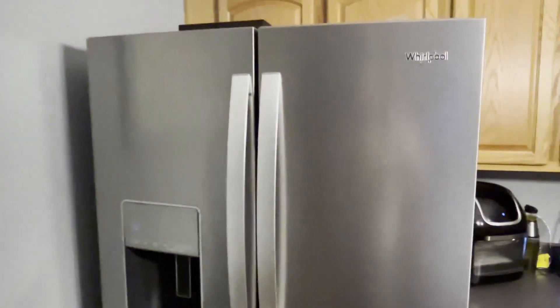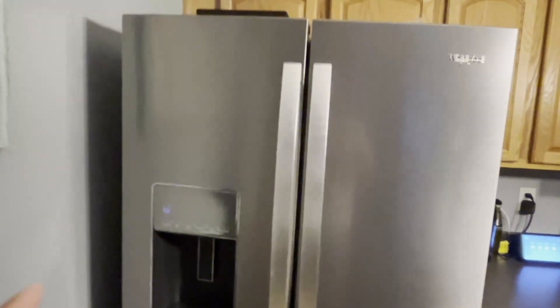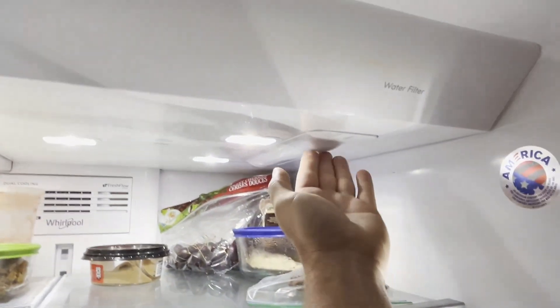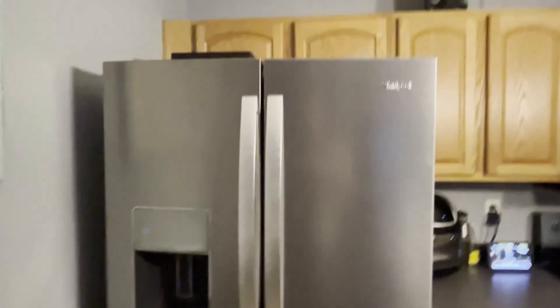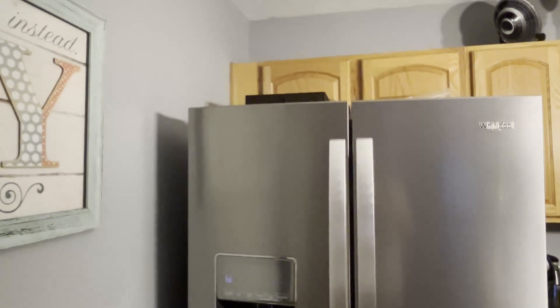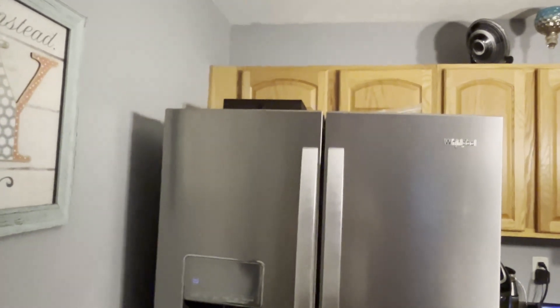Hopefully changing out that fill valve fixes your ice maker problems — for me, it did. It's now the next morning and I've got a load of ice in there, so that did the trick. If that did not fix your problem, there actually is another fill valve called a secondary fill valve. It's after the filter — the one we just replaced sends water to the filter housing, then from the filter the water goes into a reservoir and then to another fill valve that sends water to either the ice maker or the water dispenser. It's pretty similar to the one we just replaced and it is easy to replace, just a little more challenging to get into the ceiling of your refrigerator. You can find a diagram of that on any parts website. I would try that as a second option if your ice maker is mechanically working but just not producing ice.